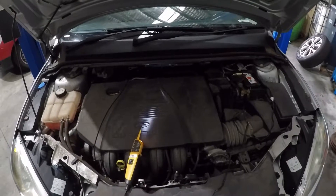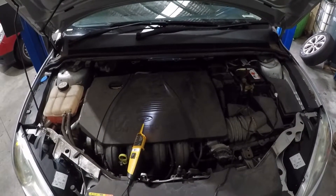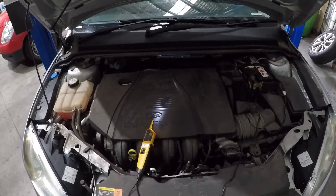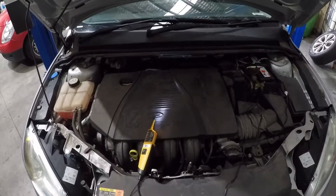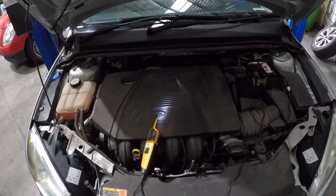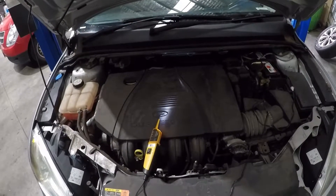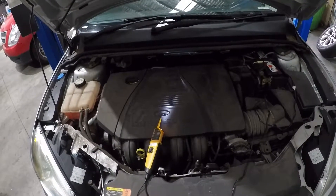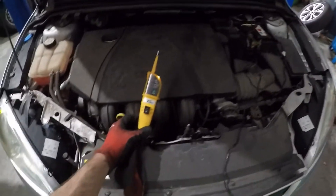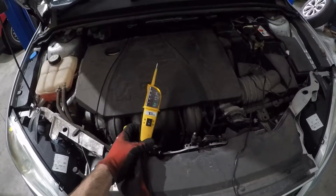This one's in for a no crank no start. When you turn the key there is a click - like a solenoid click of a starter motor - but nothing actually happens. All the lights work and when cranking, the headlights don't dim at all, so the battery looks fine. We've tested the battery anyway just to make sure, but it's looking like a starter motor. I've got one of these little power probes - this isn't an actual power probe but it's a similar knockoff - and it makes things easier.